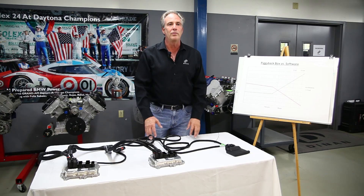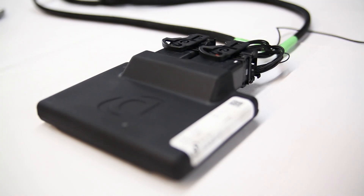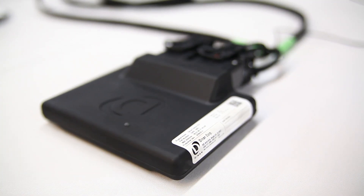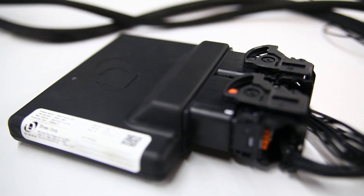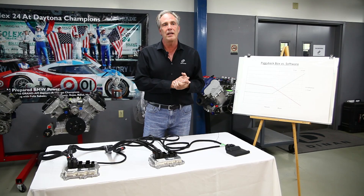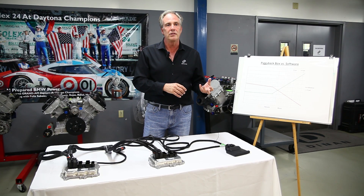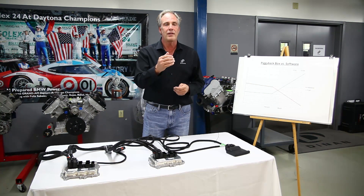This gives us the ability to process whatever we want to. We modify the same manifold pressure sensor and air mass meter as everyone else to raise the boost, but then on top of that we modify the wastegate signal to make sure it's in sync so we don't get a fault. We also program the oxygen sensor signal to the engine as well as the fuel flow, so the target fuel mixture is correct and the fuel flow is correct for the target mixture.